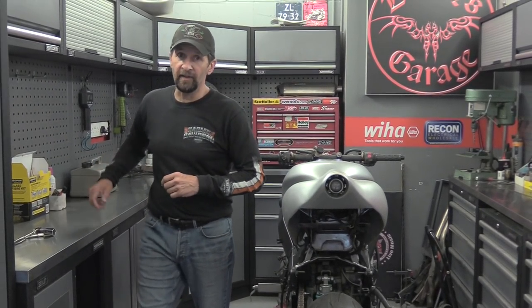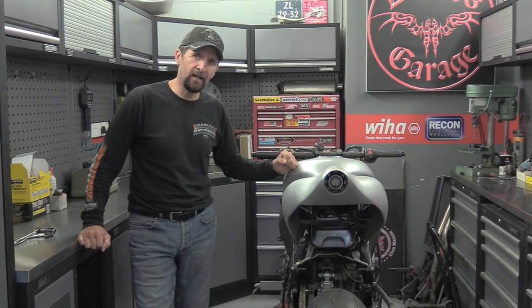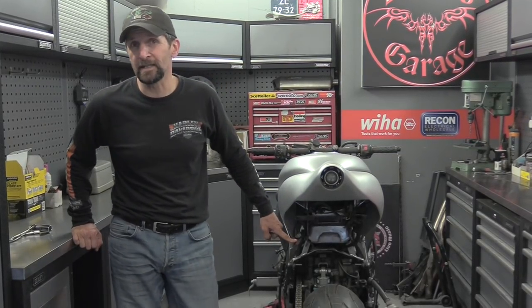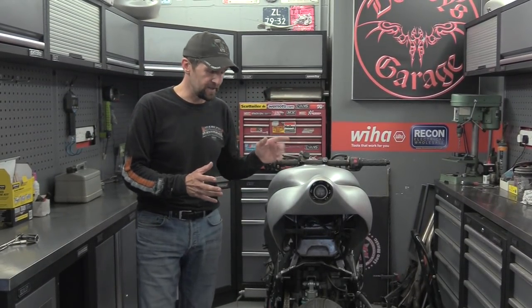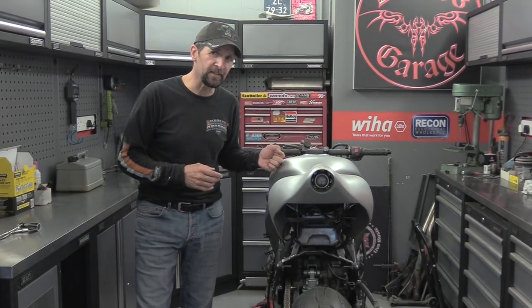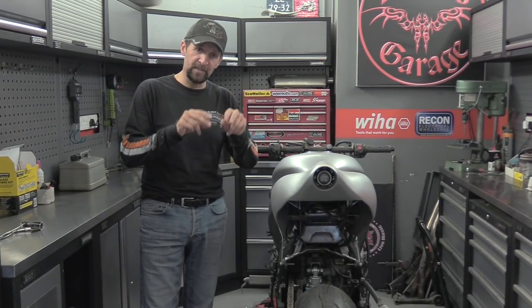That's got some fuel - and that's just the least of it honestly. This bike has been off the road now for two and a half years, there hasn't been fuel in that tank for all that time. I've got to make sure the tap itself doesn't leak. The tap itself was all working fine when it went to bed. It hasn't been run for 10 months now, which could present other problems - nothing to do with sludge or rust in the tank because that's been dry. The carbs I did run out last time - I ran the engine without fuel for about eight or nine minutes until it started to cough, hopefully that emptied the float bowls. So before I start ripping them all apart to check, we'll just fire up and see what happens.